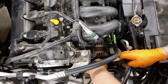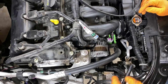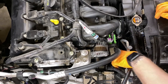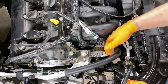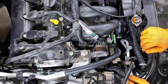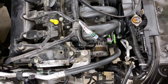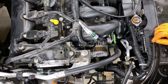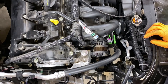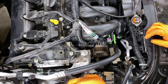Take the belt and tool off and your belt comes out. Your next part is removing your AC compressor — there's one plug and four bolts to undo it; that'll drop so you can slide it forward out of the way for the engine to come out. We'll also undo this bracket here to further swing it clear. Leave the ground attached to the engine — our motor mount will be coming out with it.